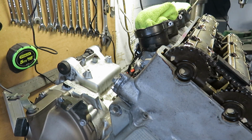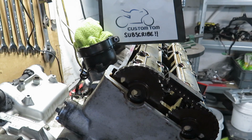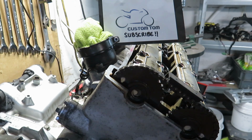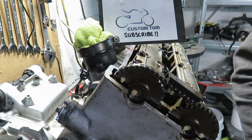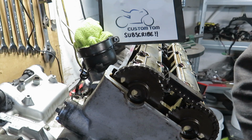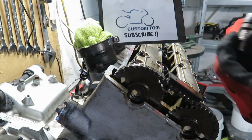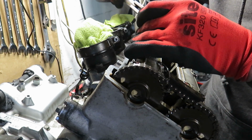Four is on TDC, so I can check them. I'm going to go around, check them. You've seen me check them, and I'll be back in a second. Righto, time to torque everything up, because I want everything to be in the right tolerances. 12 newton meter.